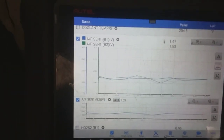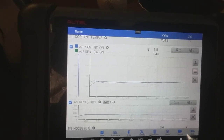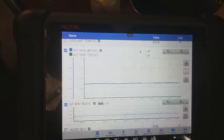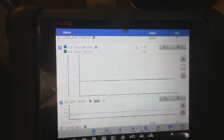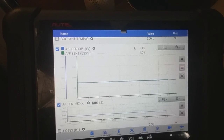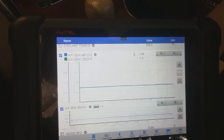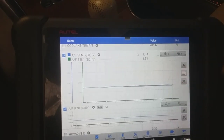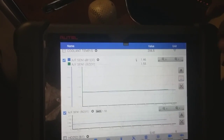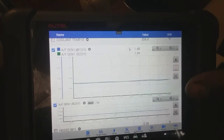So based on my past experience, based on the misfire conditions, when I pull these valve covers off, or get the intake off to get to the valve covers, since I do have to pull all the coils out, I'll pull all of bank 2 out and inspect the coils. Now, I could pull the oscilloscope out, connect to all 3 coils on bank 2, and see which one's falling off. But this seems like a classic issue with the insulator inside the coil that connects to the spark plug.